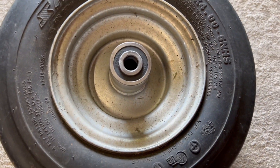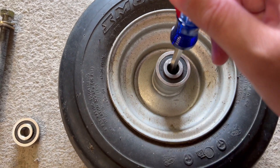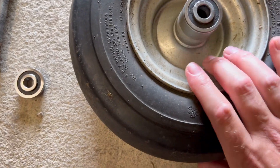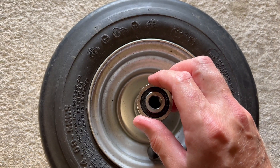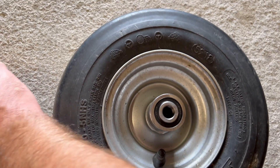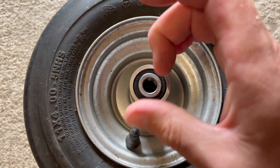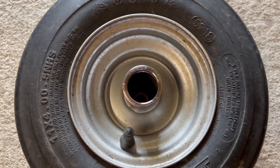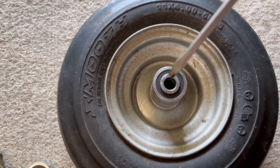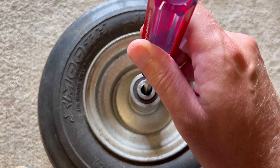The problem now is the casing itself is still in there, so I've got to get the casing out first. You can see the flange on it right there. All you've got to do is come from this side with a punch — which I have a big screwdriver — and beat it out. Once you get it out, you free up the room to get the new one in. If I can't get it in straight by easing it in and tapping with a hammer, I'll buy a threaded rod, kind of like the bolt here, and come through with a stack of washers and a nut, then turn the nut down to press it in. Give me a minute — I'm going to come from the side with the good bearing, put it through the hole, and beat it out.